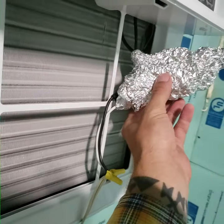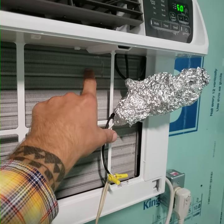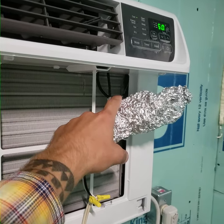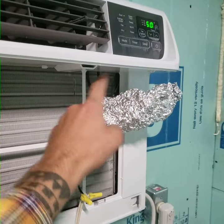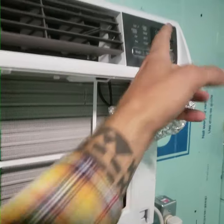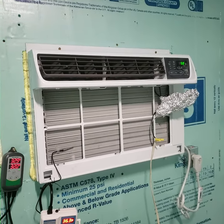This will run power to a light bulb. The light bulb is aluminum-foiled to the sensor that is originally supposed to control the temperature of the air conditioner. This will shut off when it's reading whatever temperature it's set at. So essentially you're hijacking this sensor with a light bulb, making the sensor think it's actually 70 degrees or whatever, and so it tells the air conditioner to blow cold air.